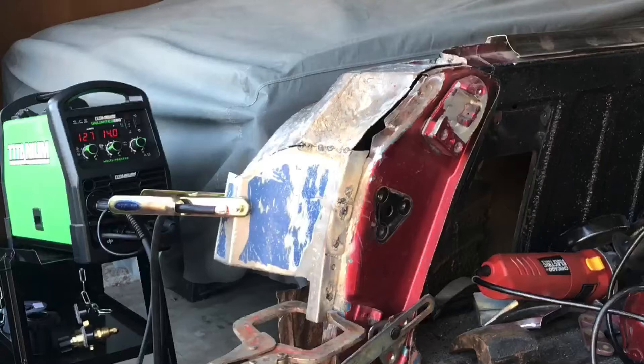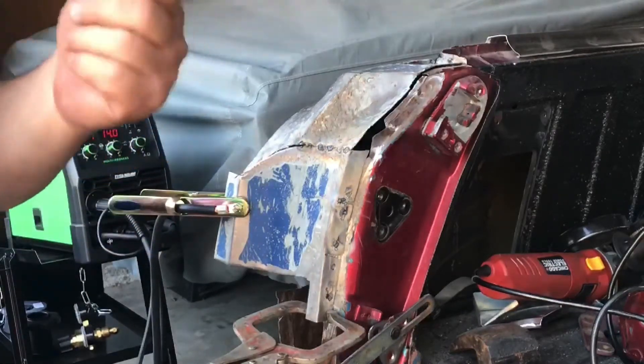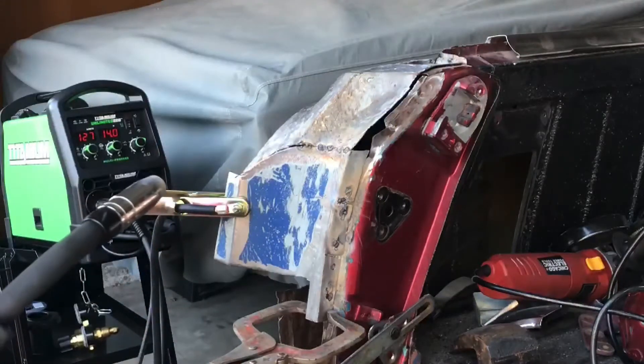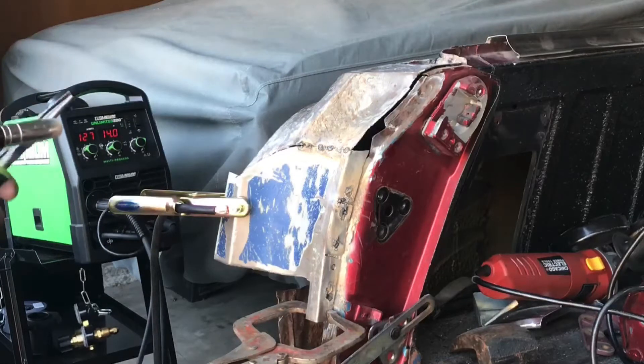Just the tack weld — let it cool. I amped the amperage up a little bit, but then you start blowing holes through the metal. It welds better, and then you've got to feed the wire a little faster. So I fed the wire a little faster. We're at 14 — I think it was at 12 before. The wire feed speed was at 8 before.